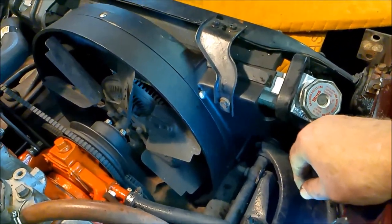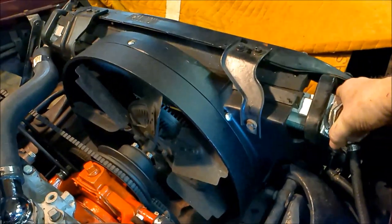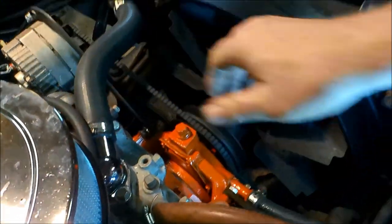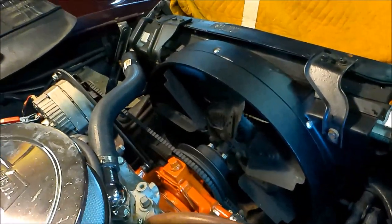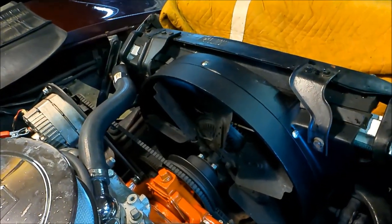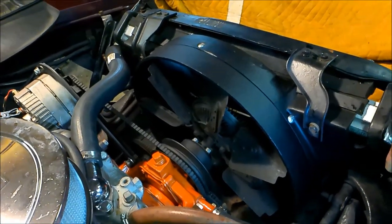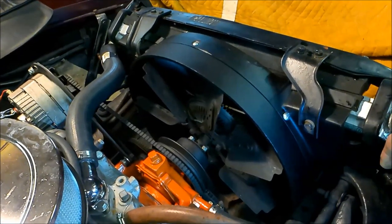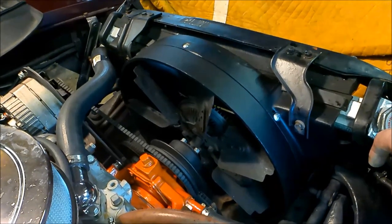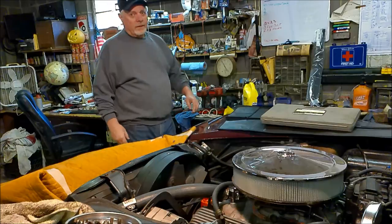Over 20 minutes. Look here. It's not even hot to the touch up here. Up a radiator hose is hot. So I believe it did finally open, because at one point I seen the temperature inside running up to getting close to 180. Then I come out here and did some checking, and I believe when I went back and looked, it was, I don't know, under 180. So that tells me the thermostat must have opened and it started cooling.